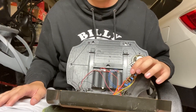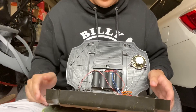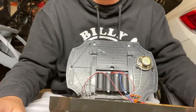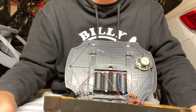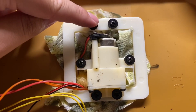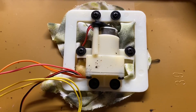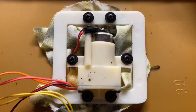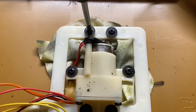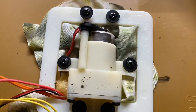So you don't want to pull any actual wires off — just be very careful, sometimes the wires are a little short. Next thing I'm going to do is remove all the screws, and I'll jump cut to show you guys which screws to remove. We're going to have to remove these two fabric screws — these are for the fabric — these two and then two more on the bottom.